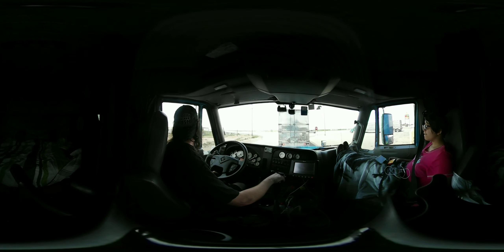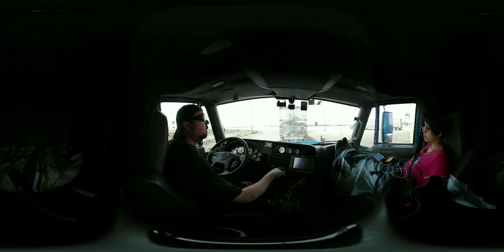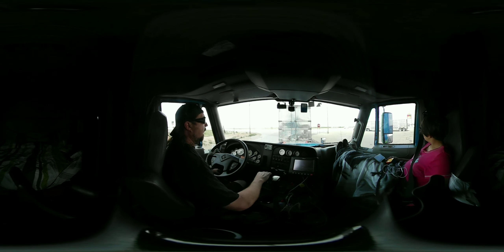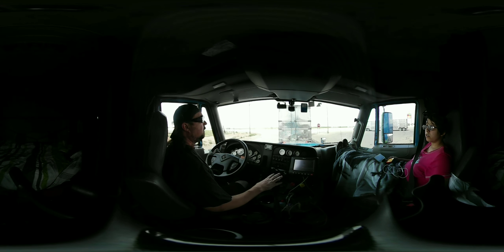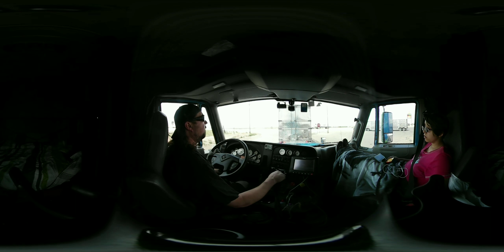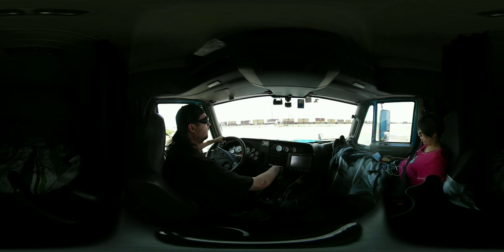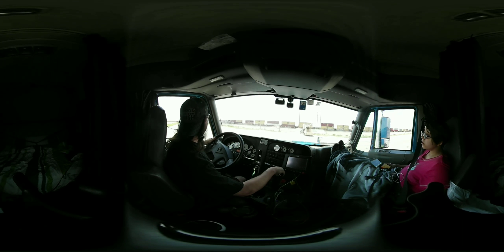Now we're here — we've got to wait on traffic to clear. It may take a minute. I'm in second gear and I have my foot on the brake. When you go to take off, you're just going to let the clutch out slowly until you can feel it start to pull on the engine. That's all you want to do when you take off — just feel a little bit of pull, then take your foot off the brake. This ensures you're not going to roll backwards, especially if a vehicle is real close behind you. We've made our legal stop at the stop sign, then pulled up so we could see past that bull hauler that was right there.